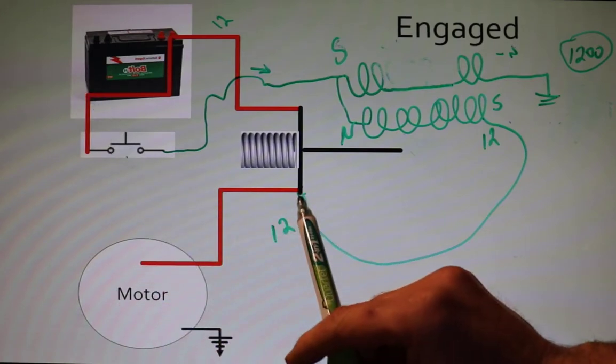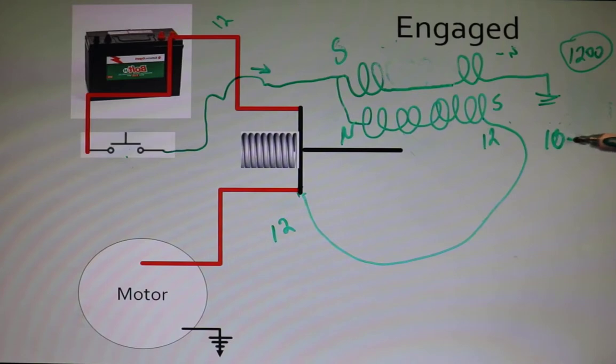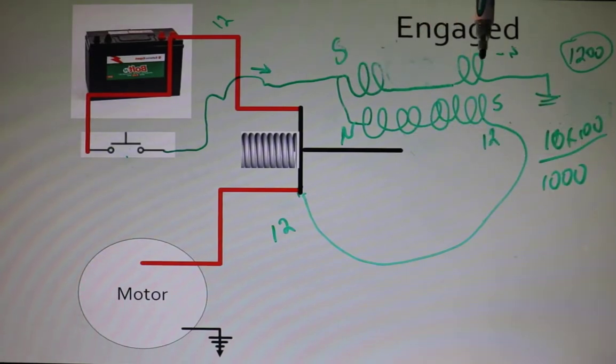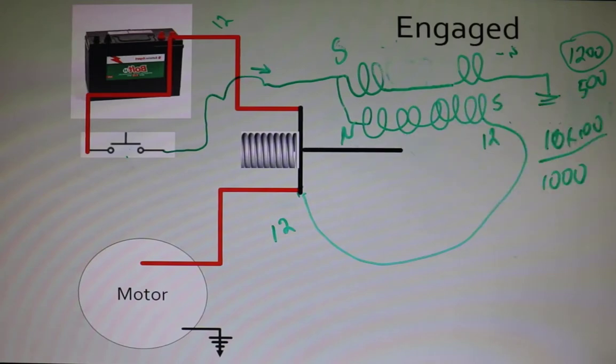The motor starts spinning, starts spinning the engine, the engine fires up, I release the button. The contact disc now supplies power back through both coils in series. Let's say we have 10 amps flowing — 10 times 100 wraps equals 1,000 ampere turns in the good coil; but 10 times 50 wraps equals only 500 ampere turns in the shorted coil. They're opposite in direction, so we cancel out 500, but there are still 500 ampere turns remaining — enough to hold the magnetic field. The starter stays engaged and the motor runs while the engine is running even with the starter button released. It doesn't matter which coil is shorted; if we shorted either one, it would do the exact same thing — the starter motor will run on.